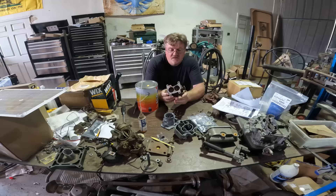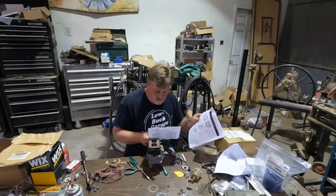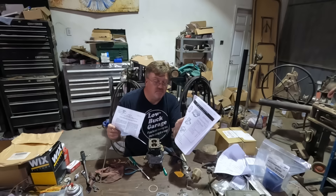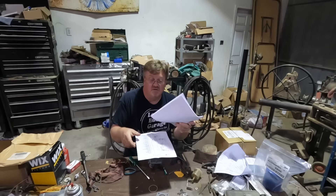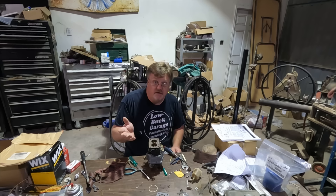The base of this carburetor is actually steel, and it was originally painted black, so I'm going to go ahead and repaint it black after I clean it up. Now the kit came with two sets of instructions — one that was actually in the kit, and a big book with like 70-odd pages. Both say to set the idle mixture screws out one turn. I checked before I took it apart and they were out two and a half turns, so we'll go one and see how it goes.